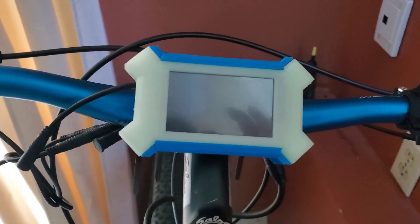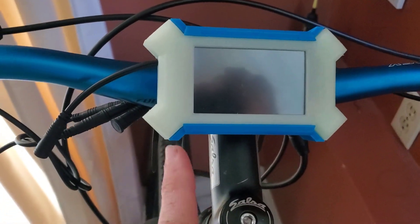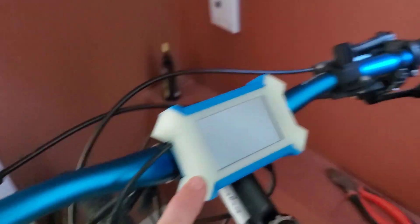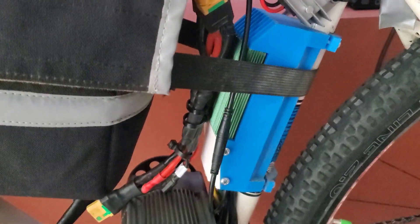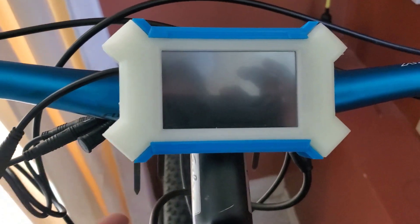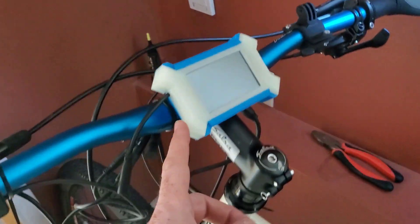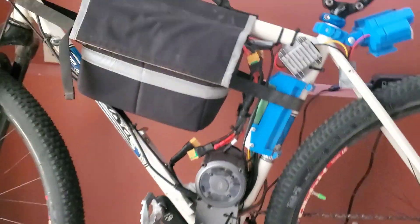In terms of the software on the NXT, it's actually been undergoing some major revisions of late and it's looking a lot more stable. Alan's been working crazy amounts on the latest update — I won't go into it too much, I'll let him do that. But essentially what has happened now is that this screen runs the whole show. Nothing will ever get flashed to your controller, which is a good thing because flashing firmware and power cycling can end up breaking things. All the commands, power settings, amps, rider profiles, speed limits, battery settings — everything is stored in the display. It pushes out the settings to the controller every time you use it, which then drives the motor. If you have a problem, you just hit reset and you're back to the defaults you had when you first set it up.